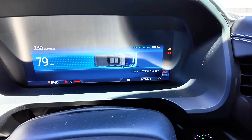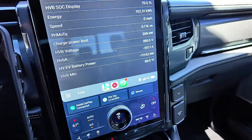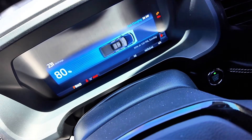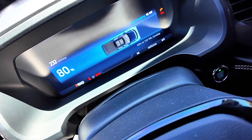Just a quick check-in before we hit 80% state of charge — we are still at 118 kilowatts, with amps dropped down to 300. That is normal for the Lightning and the exact behavior we would see without an adapter. At 80%, we've dropped down to 56 kilowatts — the exact behaviors we would see with the approved Tesla and Ford adapter as well. No difference in performance. On a road trip, you want to unplug at 80%. When you get to 80 to 90%, it really slows down, and above 90% it gets even slower. Hopping from charger to charger in the 10 to 80% range is the more efficient approach.